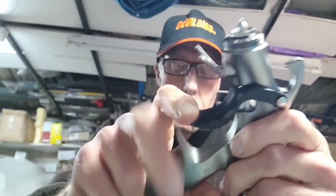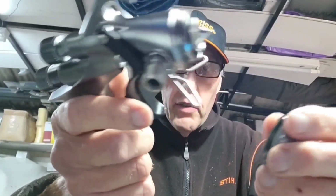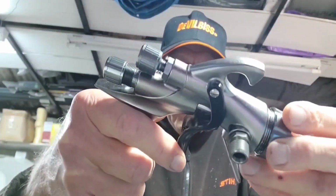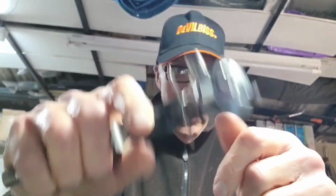One thing I will say about this, the WB, I've used it to spray waterborne base coat, I've used it to spray solvent base coat, and it actually does both really well, even though it's a 2.0 tip. Although I don't have it on full fluid, it does seem a bit much on full fluid, but it makes a cracking pocket rocket of a clear coat gun.